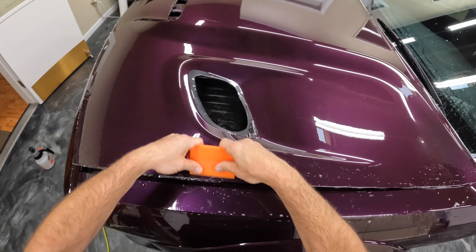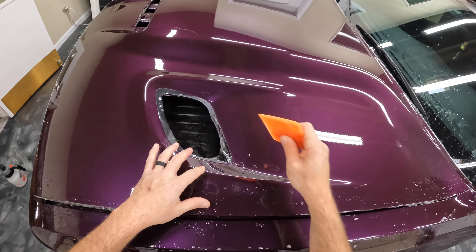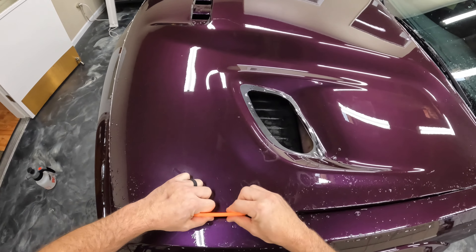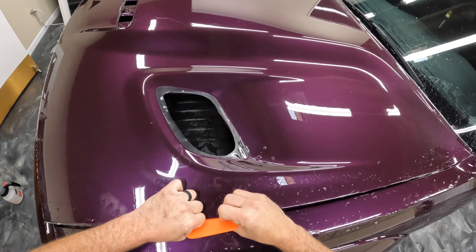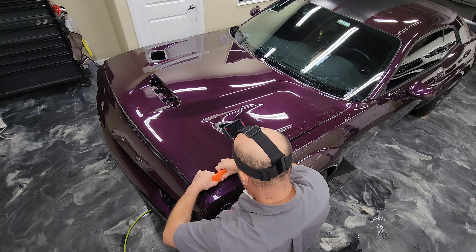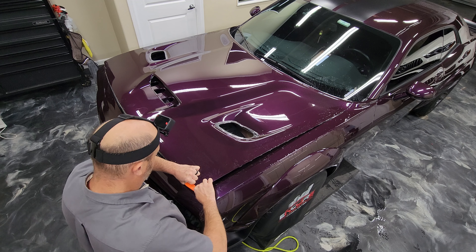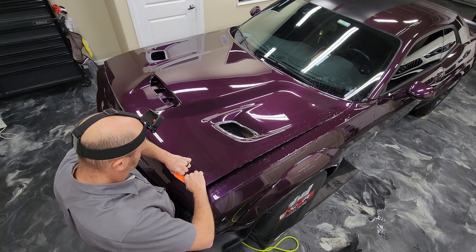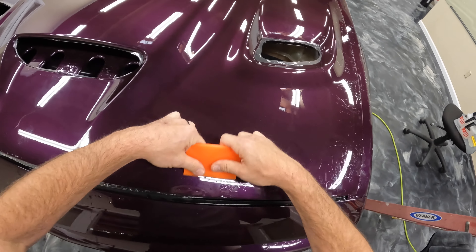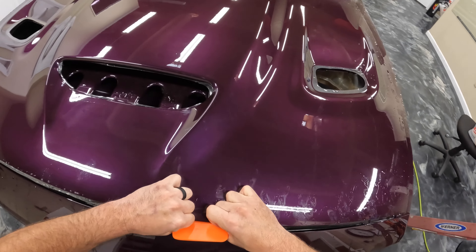The big deal with this is that if you leave that material just hanging like it is, you're going to end up with a line on that edge where it dries. Also, when you go back later to wrap that edge, if you leave a little air bubble — maybe you roll one part underneath the hood and right next to it a little part tacks down — that's going to leave a little air pocket on top of the hood that you'd then have to pick the material back up to get out. The pre-wrap eliminates all of that.